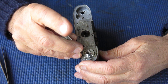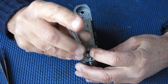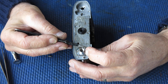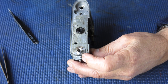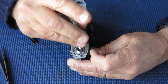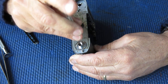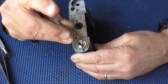That's probably where screws will just loosen up over time anyway. That's quite normal. Tripod sockets get a fair bit of abuse. Some older tripods in particular, the screw at the top was often poorly formed. Often had a bit of a taper on it. And the further you screwed it in, the tighter it went, really. But basically, it was very common for that to distort or damage the tripod socket in the camera if you went overboard. And people often go overboard.